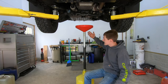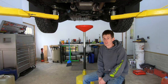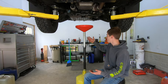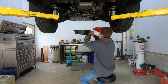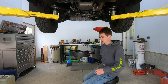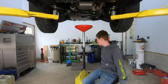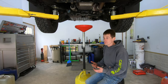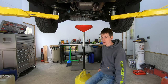Number two is the extended oil drain. This is 100% necessary. If you go to the time and expense of putting in a lift, there's no reason you can't change your own oil, and if you're going to do that you literally need one of these. The alternative is holding a drain pan in your hands and then trying to put the drain bolt back in one-handed while holding five to eight quarts of oil — don't bother. These are relatively cheap, between $80 and $100. This basic one holds about eight gallons, which is more than enough for home use on any vehicle that fits on the lift.